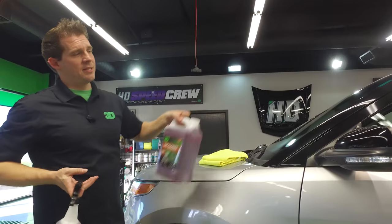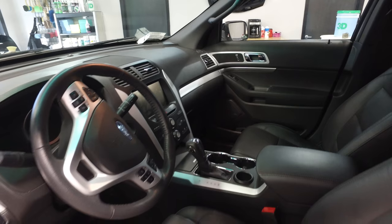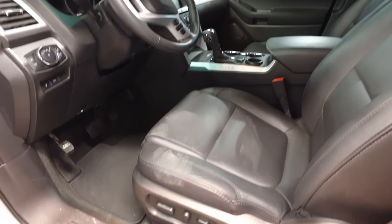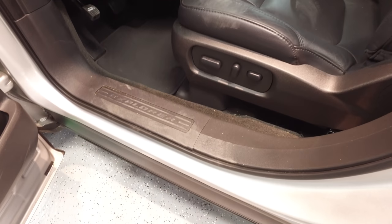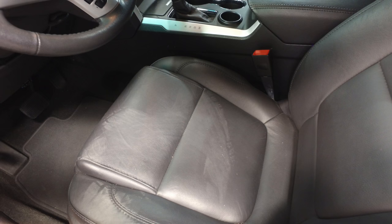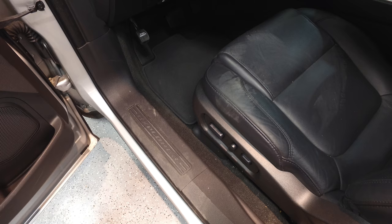We're going to go inside this vehicle — it has all leather seating and plastic trim. Whether you have dirt marks or tough stains that are hard to remove, LVP is perfect for this. You can dilute it at a 4 to 1 ratio for heavy spot cleaning, or 10 to 1 for mild to moderate cleaning, which is what I've done here. A lot of the time you don't have those heavy stains, so 10 to 1 is great for maintaining and keeping the material safe.